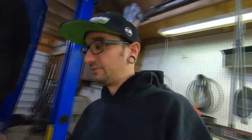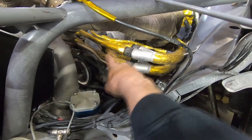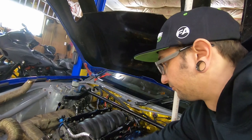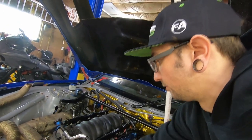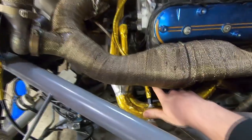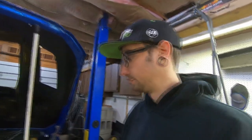For starters, the factory water pump was completely eliminated. We went over to 12 AN lines off of the actual engine block right there, and you can see they kind of come together in these Y blocks and run into hard lines that go over and down under the car. Now the steam port routing on this is a crossover in the front — this is where our steam port is. Any air that gets trapped in the motor will come into this line here, and then that line goes right into this radiator hose, which is the return. So that returns the air all the way back into the radiator.